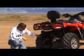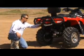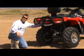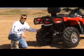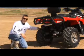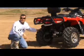One thing on the suspension I want to point out is this TTI suspension. Basically, the pivot point is in front of the tire, so when the tire hinges up, it hinges straight up instead of cambering into the machine. What that does is take a lot of the torque steering out and makes it ride a lot smoother, able to climb over rocks a lot cleaner.